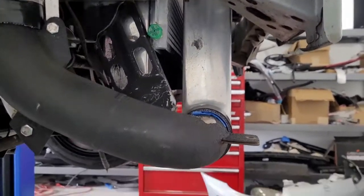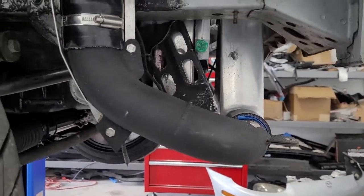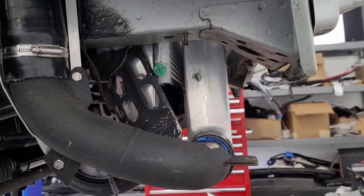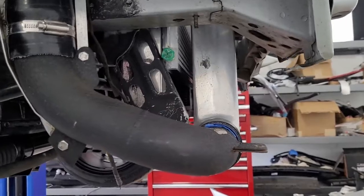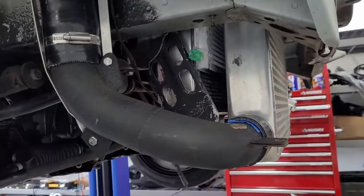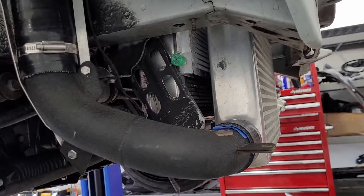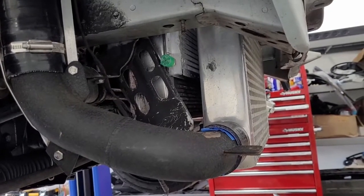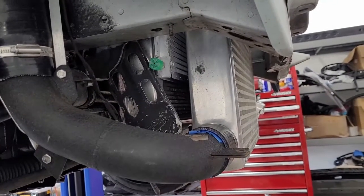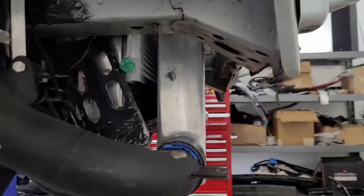But here are a couple of concerns. You can see this charge pipe. It comes out, goes backwards, angles up a little, and then turns and goes up. That may get changed in the future. In fact, it probably will. And the pipes may even go through this area I just talked about, somewhere in this region. I could do that with a charge pipe because it's easy to remove. Whereas if I put the dryer there, I'd have to let the Freon out and vacuum charge the system every time I pulled an engine. So anyway, that's one consideration.